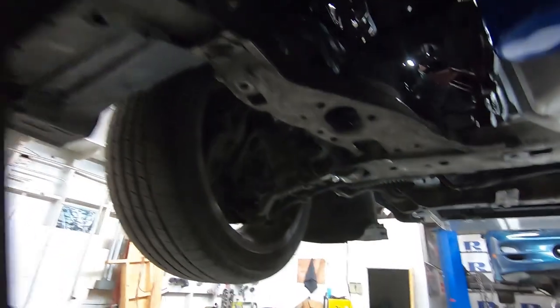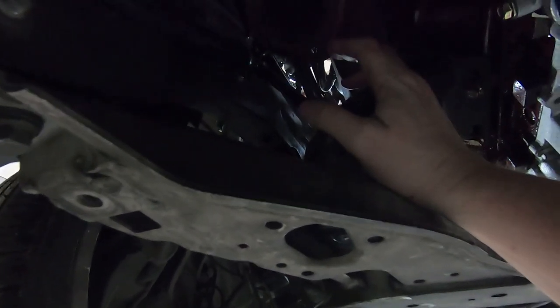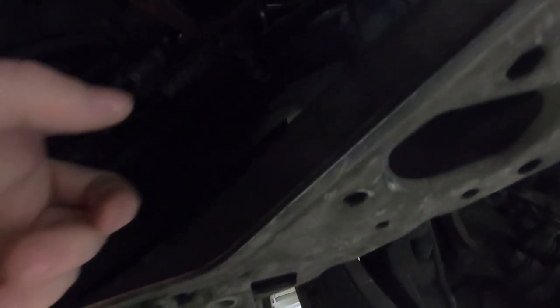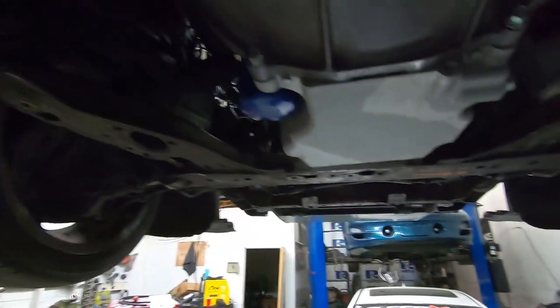We didn't know where it would end up sitting. Eventually this car is getting a set of 2-inch primary headers, but these C5 manifolds, fifth gen Camaro manifolds, are what's in here for now. But as you can see, my stock feed that's converted to AN is literally just on this flange right here. So what I'm probably going to end up doing is, instead of this straight, I might remake this line and do a 45 and kick it to the frame rail sooner. And I'll pull the manifold back out, and I'll put some cushion clamps to hold it away so nothing gets torn up from the heat. But that goes all to the top.